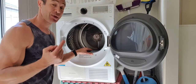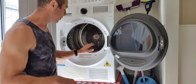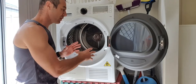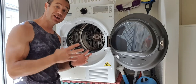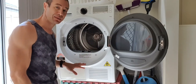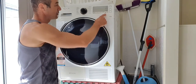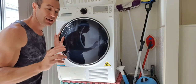Make sure that after every single operation you clean the filters. In a tumble dryer that's important for airflow, but in the heat pump dryer it's way more important than that. The bottom unit is a filter with a fine element to catch dust particles and prevent them from getting into the main heat sink. The whole idea of the heat pump dryer is based on an air conditioner principle, and if your heat sink gets clogged, operation stops. The heat sink is the most important element to keep clean. Samsung recommends cleaning this filter when the filter warning light illuminates — but if you want to look after your expensive purchase, empty and clean the filter every single operation.